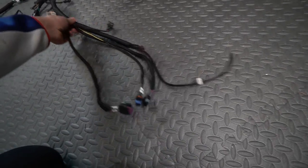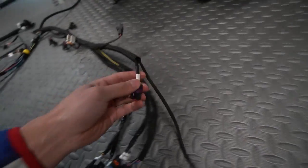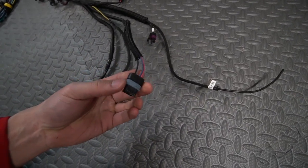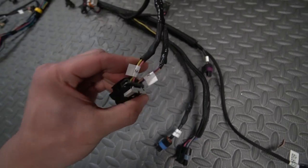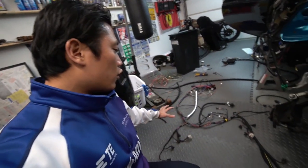Injector connectors one, two, three, four — because it's a V8. Coming down is basically the sensors you're going to be installing into your throttle body. First up you got the throttle position sensor, a starter signal cable to send signal to the starter that the car should be starting up and cranking. I got the idle air control sensor so the ECU can control the idle speeds. Over here I got coolant temperature so the ECU knows engine temperature. And last but not least I have the mass air flow sensor and intake air temperature sensor. And that is all you need to get your LS engine up and running — you don't need anything else, and that's the beauty. That's one of the reasons why I decided to go with the LS engine instead of like a 2JZ or an RB26 or any other turbo platform. There's no vacuum lines, boost lines, or any additional sensors that you have to worry about. It's so simple — this is all you need to run an LS engine.